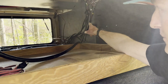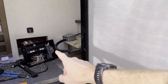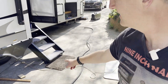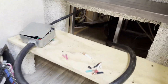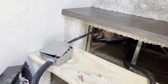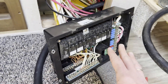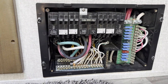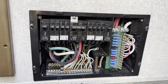I need to run another cable back to connect to the original breaker box inside of the camper, which is right there hanging out of the wall. The cable I need to run is laying in the driveway right here, so let's get that into the camper. I fought this big thick cable all the way from the pass-through under the stairs, back out, and now I need to connect these four conductors back into my junction box — my original junction box. We got it wired into the switch box, so the main circuit breaker is done and now it's time to add the sub-panel.